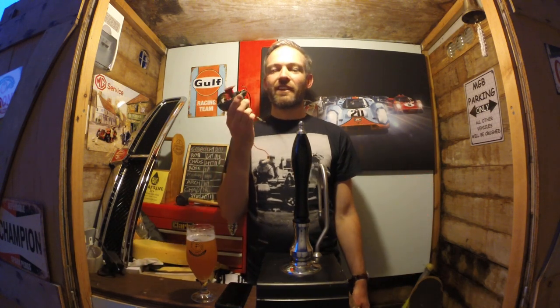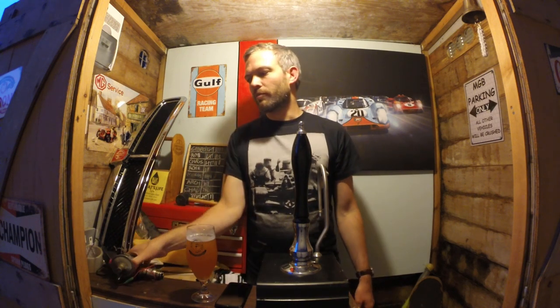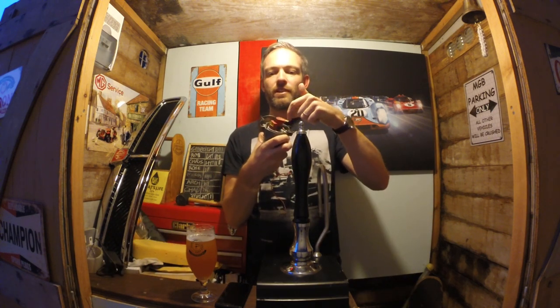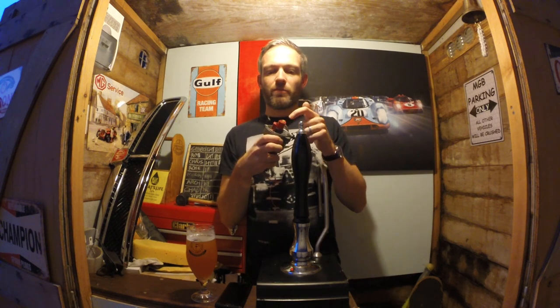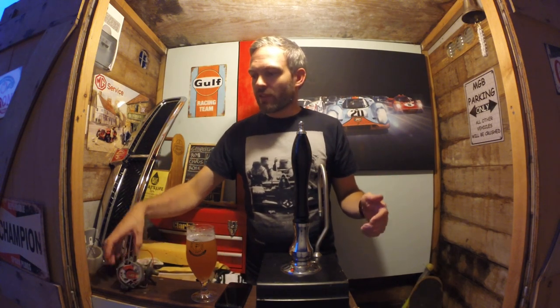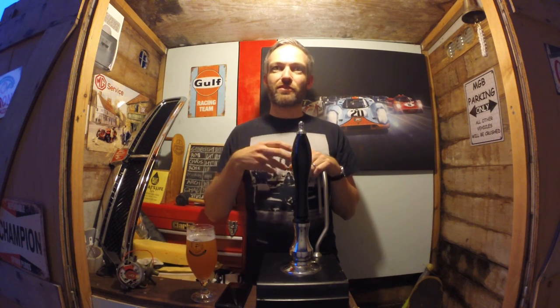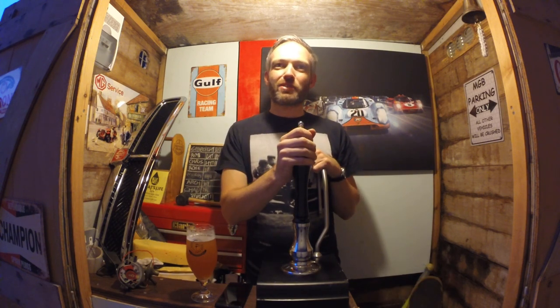So electronic ignition is the way to go, but as a backup I always keep this old distributor as a spare in the car, just in case the electronic one fails. The thing about electronic ignition is there are no user-serviceable parts inside. The rotor arm and distributor cap are common to all these distributors, and you'll still want to replace them occasionally. Also, poor quality rotor arms cause problems — best to go for the red-style ones rather than the black ones, as the carbon content in the black plastic can sometimes cause a short.